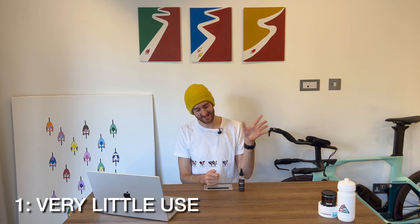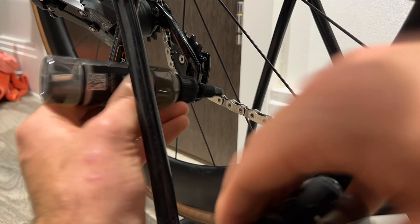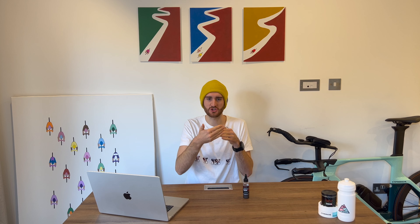The first benefit is that you hardly use any of it. With a perfectly clean chain, I tend to apply one drip per chain link, and that's all that you need — more than enough to keep your chain running. Then just run the chain through backwards about 12 times. I tend to keep it in big at the front, big at the back, because that articulates the chain a bit more and gets the lubricant deeper into the links. So you hardly use any of it, and therefore it should last the duration of your chain.